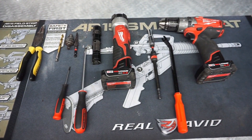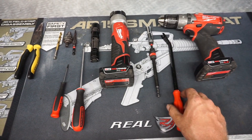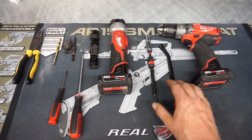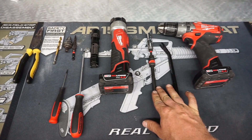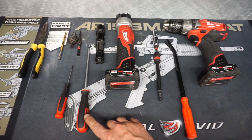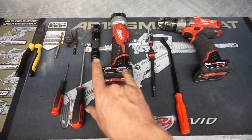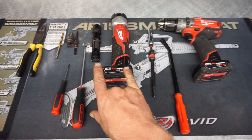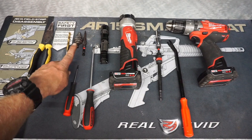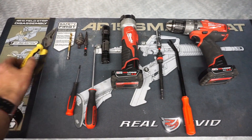What we'll be using today to install the bowtie emblem: first you need to remove the grill. In order to do so you'll need a pry bar to open up all the plastic clips. Once the plastic housing is removed, take your 10 millimeter socket — I used it in a 12 volt drill. You'll also need flathead screwdrivers for any prying, a flashlight, a quarter-inch drill bit, a small step bit, a large step bit, and something to cut zip ties with.